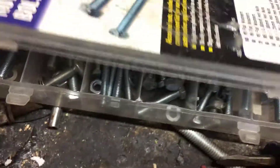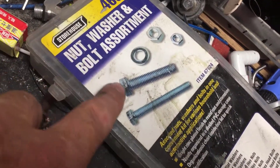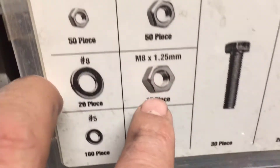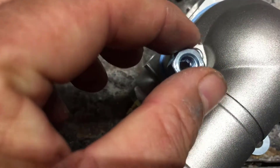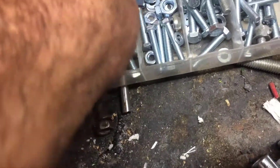We're looking for the M8 x 1.25 nut because that's the thread we need. Luckily I have this Harbor Freight assortment of bolts, nuts, and washers — they have the M8 x 1.25 right here. That's the one I need. I grabbed the biggest one, and you're going to see it fits perfectly. This one's got a little bit of thread shavings inside, but anyway...